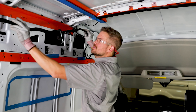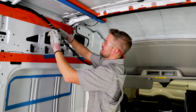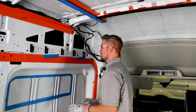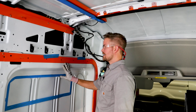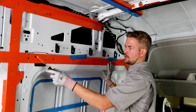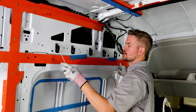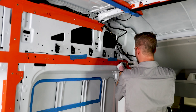Upper bar is done. Now we move the tape cable tray — just stuff it up here where it's going to go. Moving down to the bottom side: we have a set screw here and another one over here. Like in Part 1, those temporarily hold the piece in while you drill the holes out. Now we undo them — there's painter's tape up here to keep it from falling on the floor.